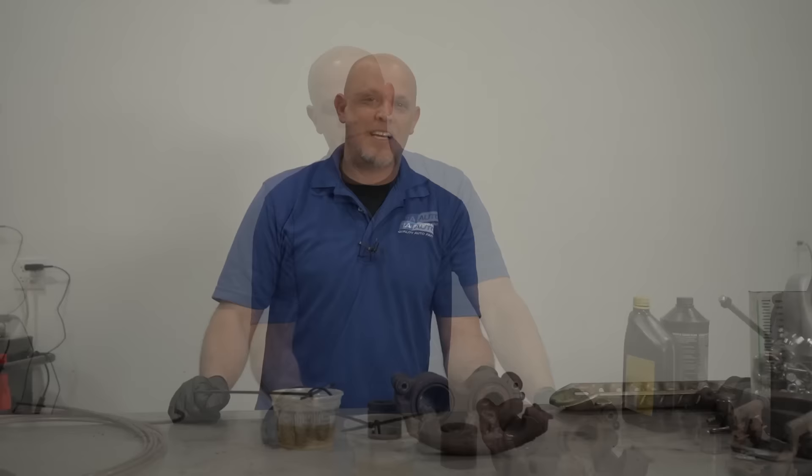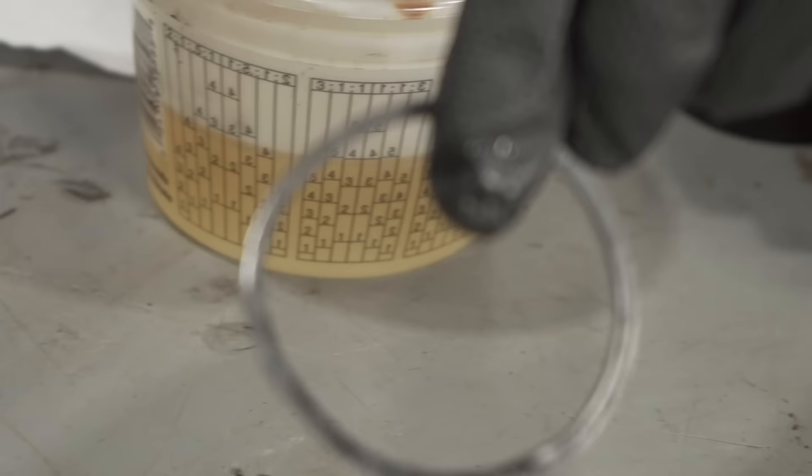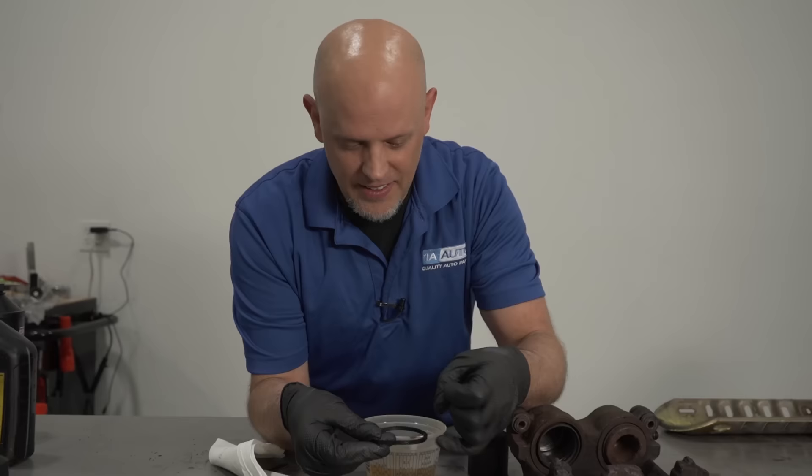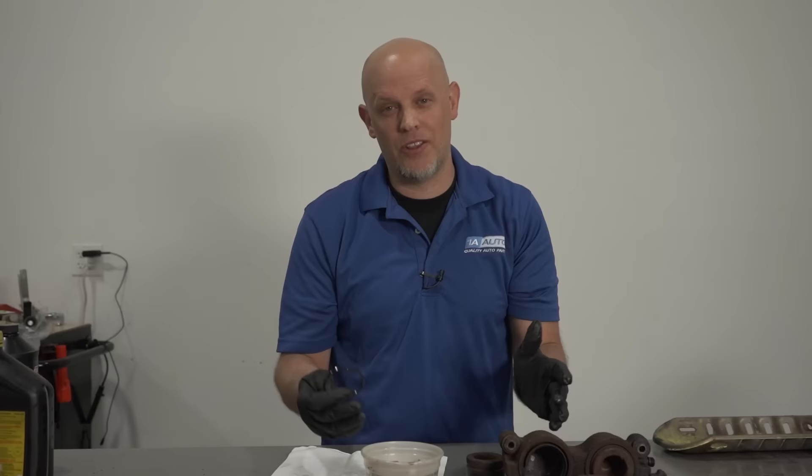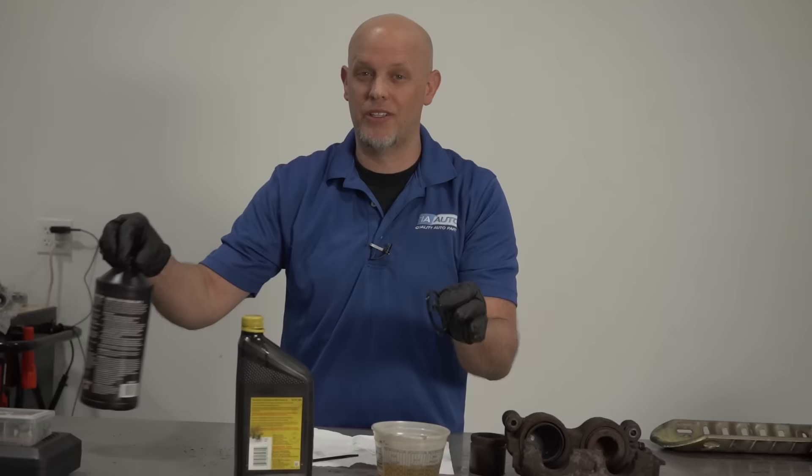We left a caliper O-ring sitting in a mixture of brake fluid and oil over the weekend — let's take a look. You can see right off the bat it's definitely warped and swollen. You don't want this in your brake system. If you get oil in there, you're going to have to replace your entire brake system — all the seals will be leaking, the caliper will be leaking. If any of that fluid gets on the brake pads or brake shoes, you'll have to replace those as well. That was only a cap full of oil in that amount of brake fluid, so remember: don't mix oil and brake fluid, don't mix anything with your brake fluid.